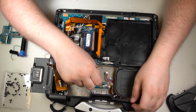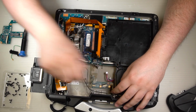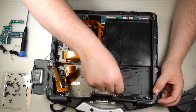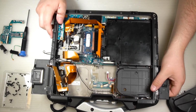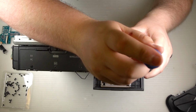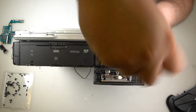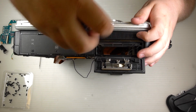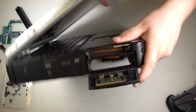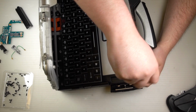And there's another little piece of adhesive over by the fan, and then it runs alongside the fan. Just lift it up carefully. And then you just need to remove the fan exhaust filter cover, and the antenna is right underneath of it. There's just 2 screws to hold the cover on. And then there's 1 screw that holds the antenna itself on. Just undo that 1 screw, and then you can pull your antenna wire through.